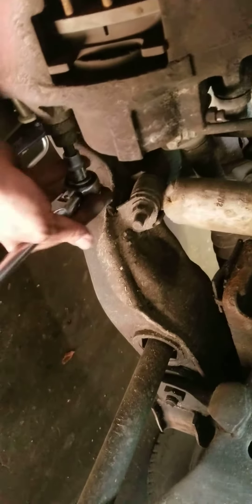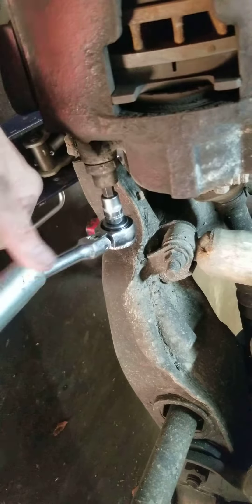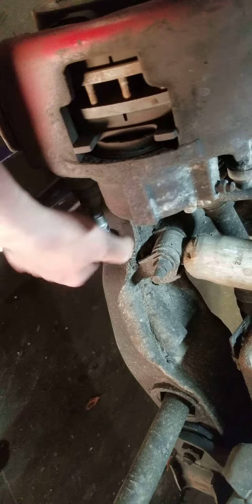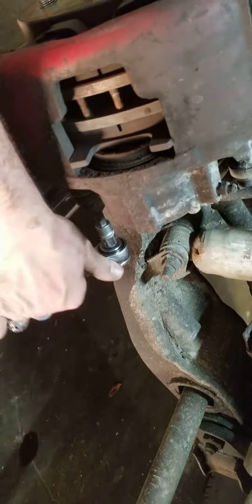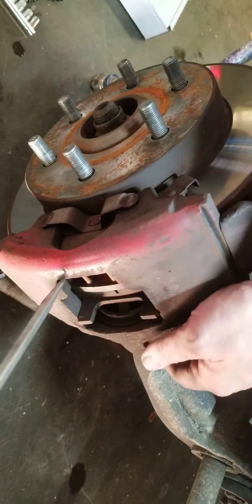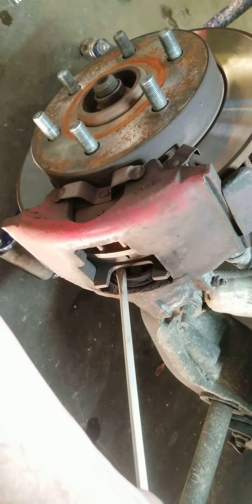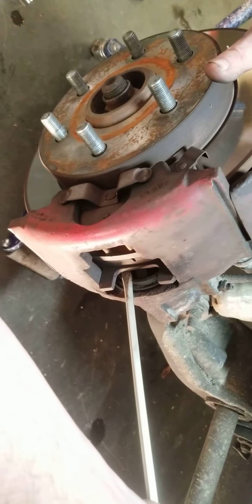With the tool of persuasion, I like to push the piston in gently, leave a little bit of pressure — kind of loosens it up, makes it a little easier to come out. When you do this, it pushes the brake fluid back up through the line and into the reservoir. Just apply gentle pressure and wait patiently.